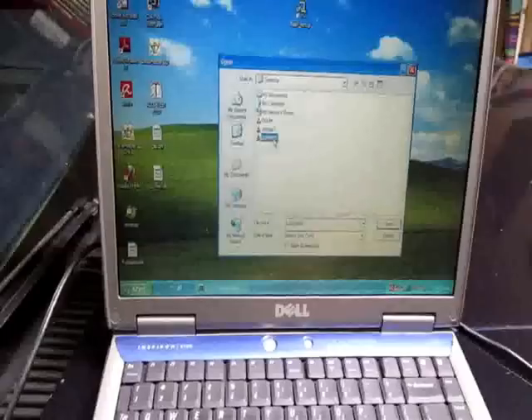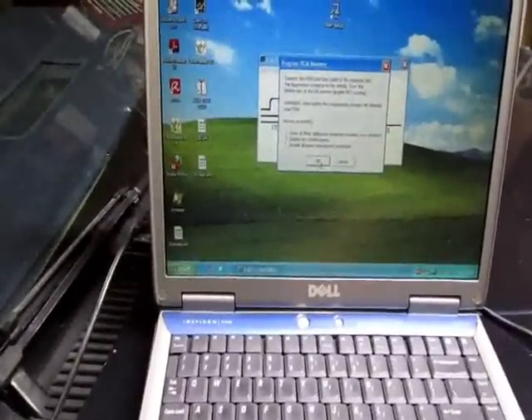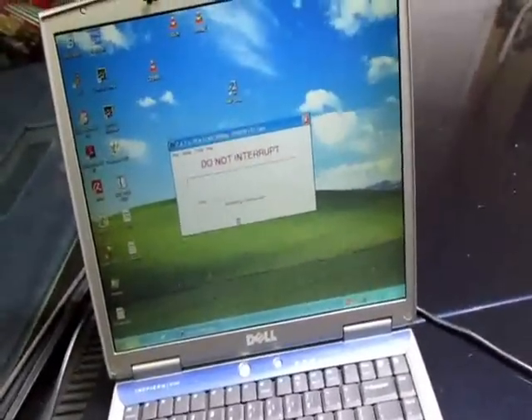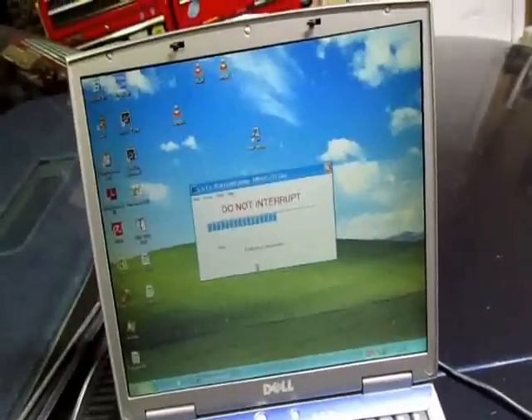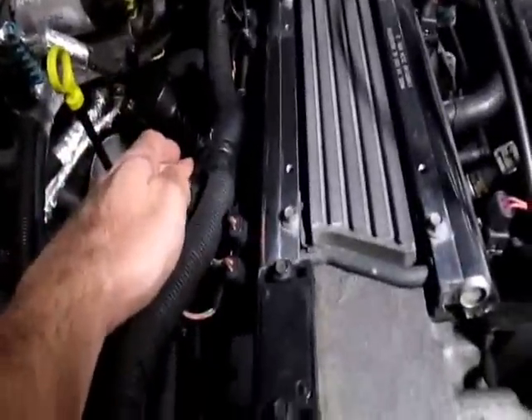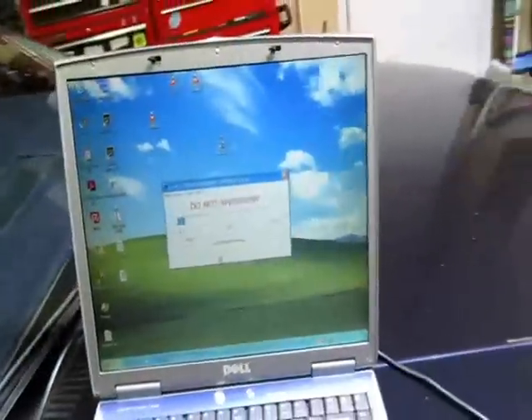I'm going to try this one — open it up. This should be a 91 tune. The ignition is still on. Yeah, we're all set. You just got to wait — the computer is going to freak out again. A bunch of things clicking. This is the EVAP solenoid making that noise — I thought it was the IAC but it's EVAP. Then we wait — it erases and programs.